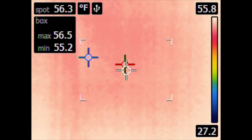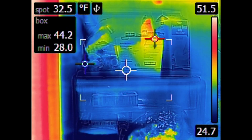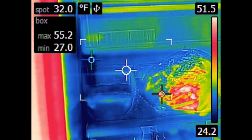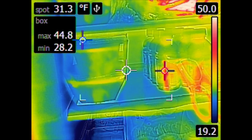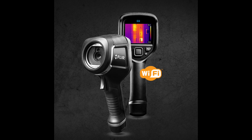I'm looking for an even temperature top to bottom. If I have, say, 20 degrees on the top of the freezer and negative 15 on the bottom, I know I either have an airflow issue like a bad fan, or a defrost issue. If the compressor is on and I see anything over zero degrees, that tells me I probably have a sealed system problem - and that's where I would start diagnosing.